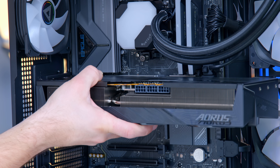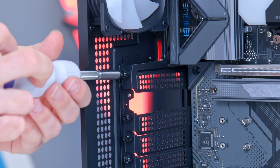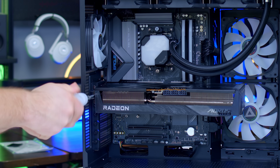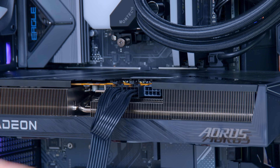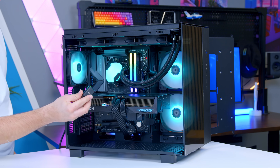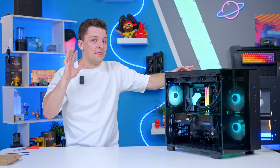Then it's time to wrap up with the GPU — hover it into place over the top PCI slot. It's the first and second lane covers to be removed; they have thumb screws, so take them out with a screwdriver rather than your thumbs as they'll be too tight, and keep the thumb screws to fasten the graphics card back down. There's a little unlock button for the PCI latch — slide the card in, press it down, and that's all there is to it. A couple of screws to secure it, and then a trio of 6-plus-2 pin GPU power cables to give the card the power it needs. Powering on — the CPU cooler fans are spinning. The fans are a little noisy, so I need to plug the CPU fan cable from the fan hub into the CPU fan header on the motherboard to calm them down.